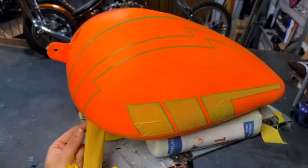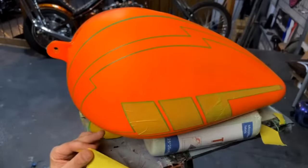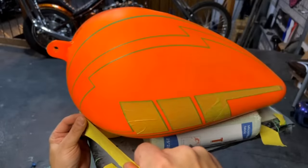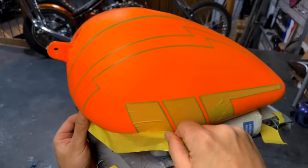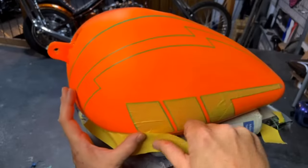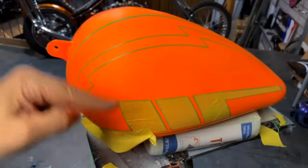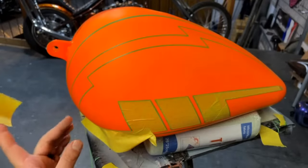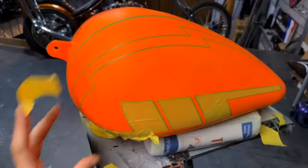To duplicate that to the other side, are you going to use a pounce pattern? No — pouncing works better with pinstriping because you're usually not taping. When it comes to pouncing, the chalk you use can cause problems with your tape sticking. What I'll do is just run a piece of tape horizontally across the tank to create guidelines and as long as they're close you're going to be fine. Pouncing works, but not as well when it comes to custom paint — for pinstriping it works great. That's definitely an old-school method.